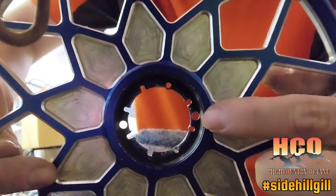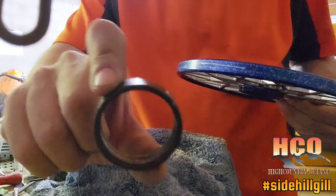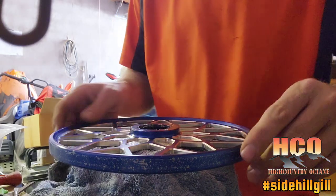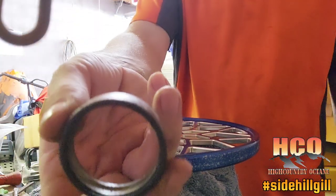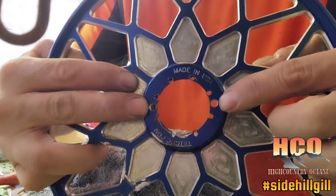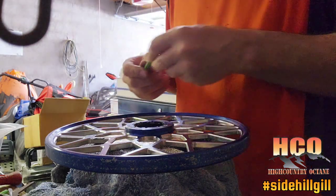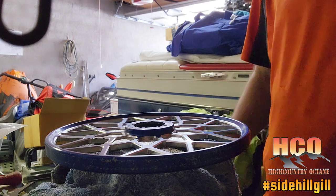There's a little bit of meat on the smaller holes that come from the TKI-made wheel, and I'm not sure how other designs fall into this category - I kind of just eyeballed it when I drilled. Unfortunately I chewed up the outside hub pretty good, but the sled needs to be back on the snow. So there you go guys - 13/64 holes, line them up with a pilot first, get started with the pilot, and a 3/16 by 3/8 punch will knock that sucker out. Hopefully this helps!